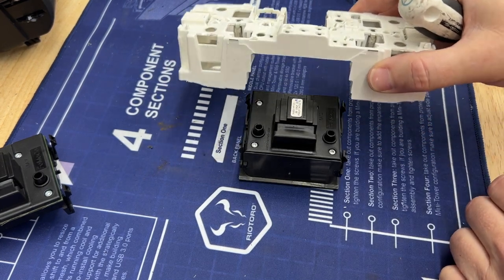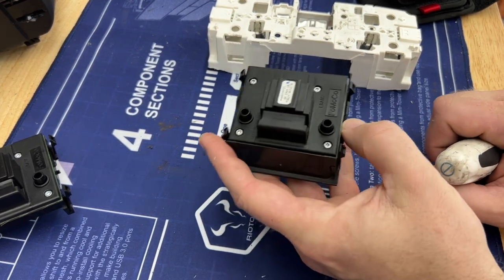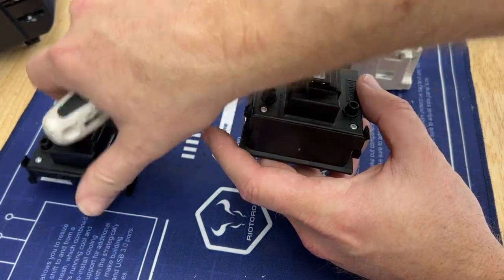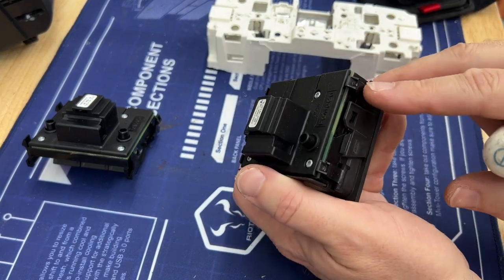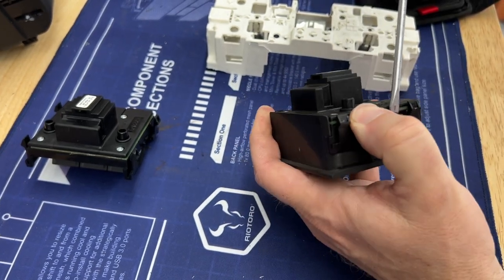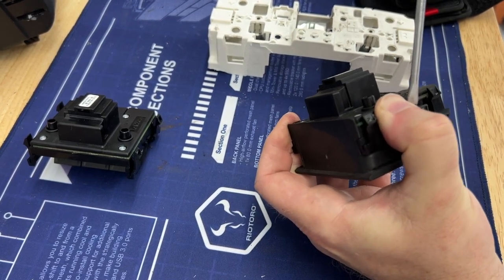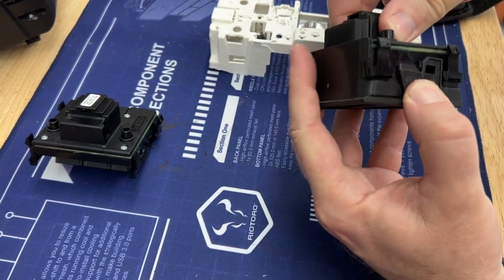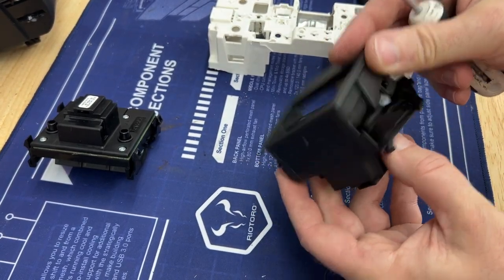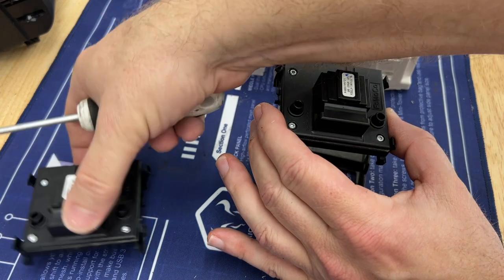When separating them, I kind of try to leave them in the same orientation so that reinstallation is easy. The first time I did this, I didn't realize that there was a housing on the switch, so I went ahead and tried to reinstall just the switch without the housing. But there are a couple more plastic clips — you can see right here there's just one little tab that you have to lift gently. Got that side coming out, and one more over here, and our bezel will come off.